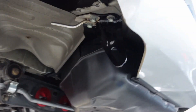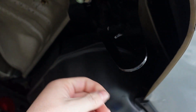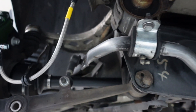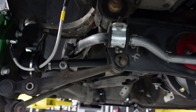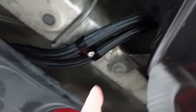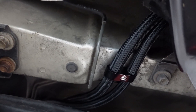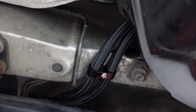Starting here in the back — I also want to show the tow hook back here, which I had powder coated since it was just rusty and crusty. You can see the whole back end needs to be dropped and done too. Look at all that rubber still in there — bushings probably need to be done. But here's the fuel line: I use these hose separators, drill them out since the other side isn't a through hole, then put a 10mm bolt that's a little longer through them and use factory holes to keep the hoses separated and tight instead of zip ties.